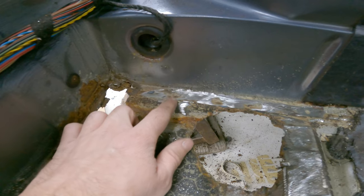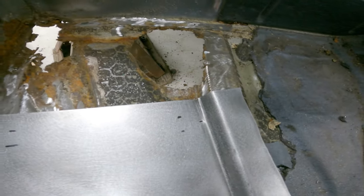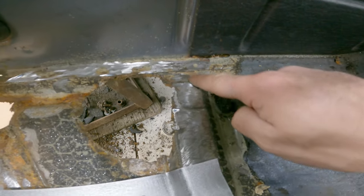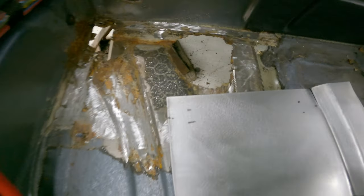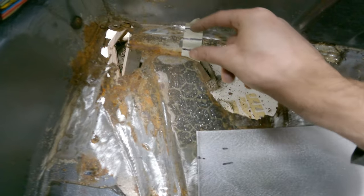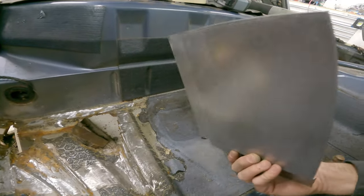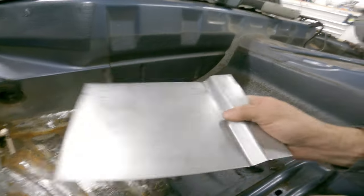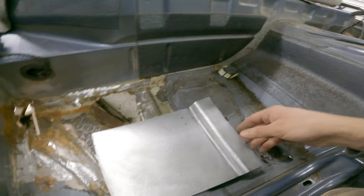I've already got the first bend done on the brake. The problem is the back — the floor is on one level and then has a big half-inch to three-quarter-inch step up, so this part has to be flush with that part. I've sliced it here and I'm going to press it in the brake using a tape trick: lay a piece of tape on the area, mark your bends where you need them, take it off, transfer it to the metal — you don't have to use a measuring tape. Also, always sand the metal first before bending, so when the piece is done it's already sanded and you can just prime and paint it.